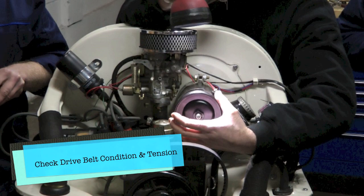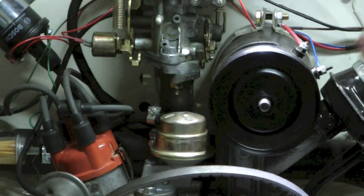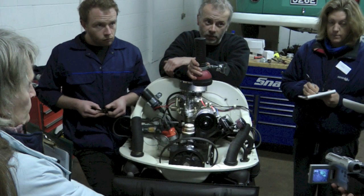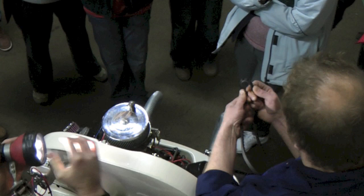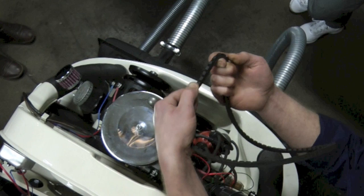To set the tension, you just have to keep taking the shims in and out until you get it where you want it. The first time you do it, it's a bit of a rigmarole — that's too tight, put some shims in, that's too loose. You should have around about 10 in the set. If you get hold of the belt when it's in the car and stretch it — if you see it's all cracked inside like this one — it's time for a new one. This one isn't in active service; it's all cracked in there.